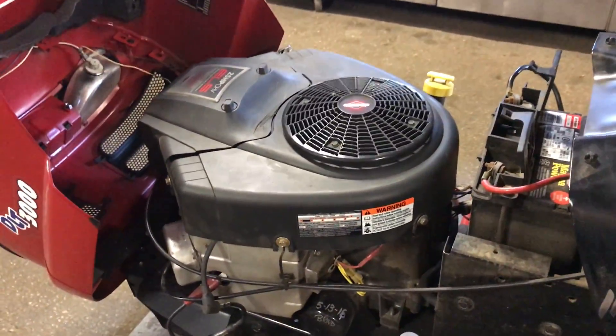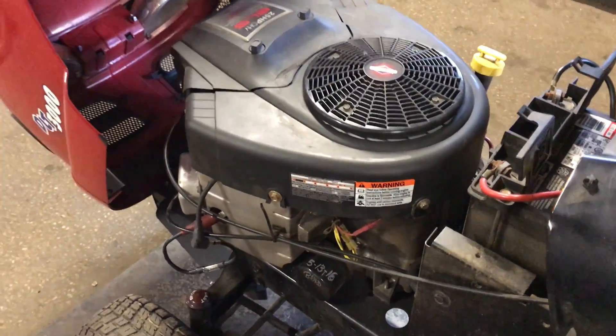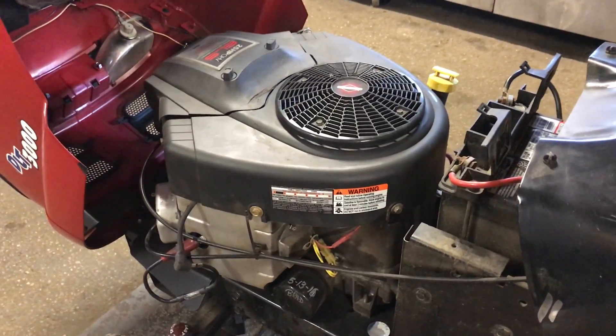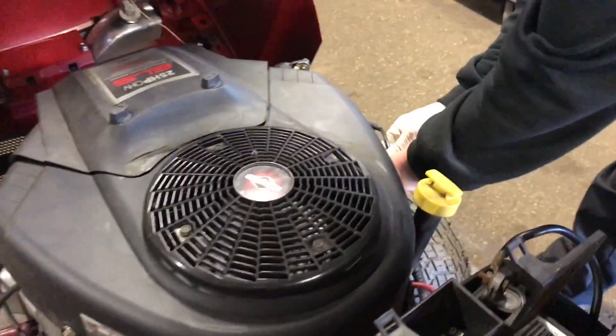As you saw, there was a nice bright orange flash on the left side, and absolutely nothing on the right side. This is a twin cylinder — it didn't sound horrible — but it has a bad ignition coil, a dropped coil as I say. So I'm going to remove the ignition tester wires and get them out of the way.